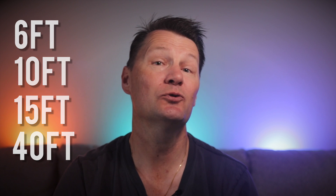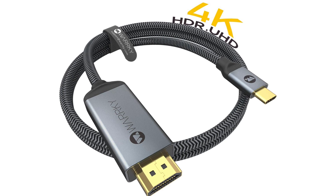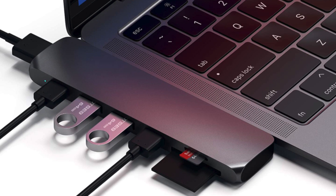If your monitors are more than five years old they may not support HDMI output and you may need a different cable. These cables come in various sizes: just over three feet, six foot, ten foot, fifteen foot, and forty foot lengths. Also recently, HDMI to USB-C cables have become available, and if you use one of these it means you don't have to have a dongle or adapter — you can plug the cable directly into your laptop. I've linked a good option below that supports 4K. Bear in mind though that whilst this is convenient, it does mean you can't use that computer port for anything else, so if your computer doesn't have many ports it might still be worthwhile using a dongle so you can attach other peripherals like mice, keyboards, or USB devices.